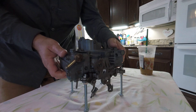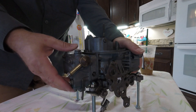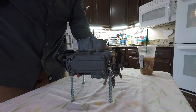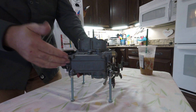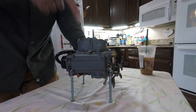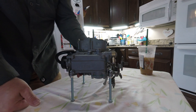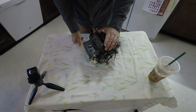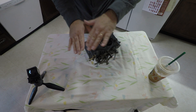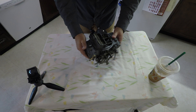I fixed that. However, when I put it back together the second time, it was leaking here. So I took it apart a third time and then I tore this gasket in here. Because as I was politely informed in somebody else's video, don't stick a screwdriver inside because you're going to tear your gasket — and that's exactly what I did. But every time I put it back together, I did not torque everything appropriately, and I noticed some of the gaskets had spread, mushroomed, which is not the right way to do it.